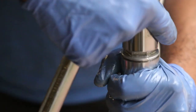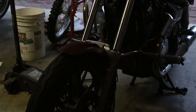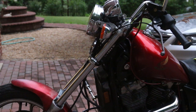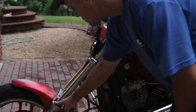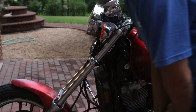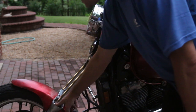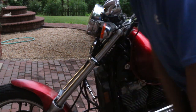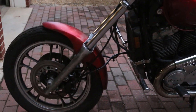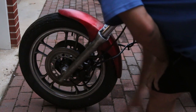That's pretty much it — not tightening it fully yet. Make sure you put the fender on before the front wheel. That is the fork seal job done on the 1985 Honda Shadow — it's not leaking anymore. After pumping it several times there's no leakage. Take it for a short ride and pay attention for any leaks, but with new seals, new dust caps, and a new retaining clip on a 35-year-old fork, you likely won't see any oil. Make sure every bolt is tight, especially the bolt underneath.